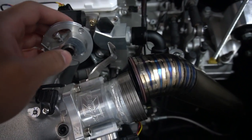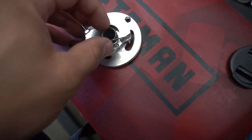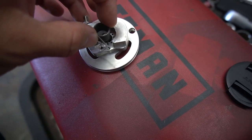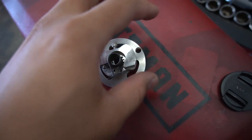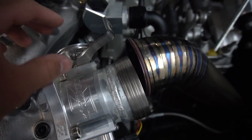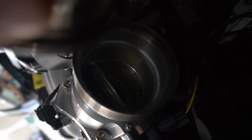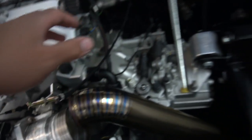We're going to slide this back in and then adjust everything and test it again. I took it back off because I noticed I could go even tighter — instead of the fourth spot down, I'm actually going six spots down from the right side, almost right in the middle. I put that back on — the butterfly was open, so before tightening the screw you want to make sure it's fully closed. Then go ahead and tighten that screw up.